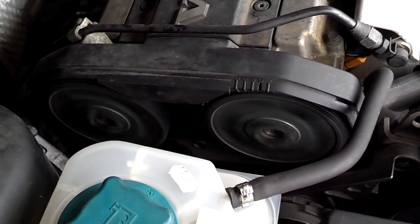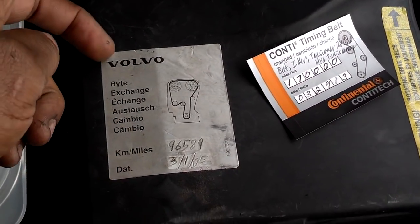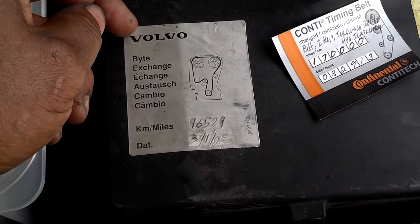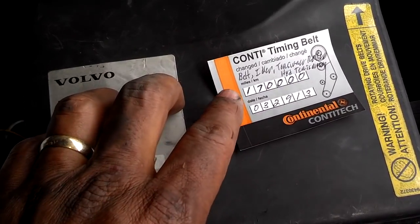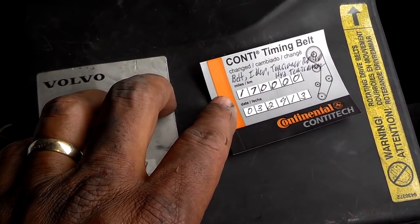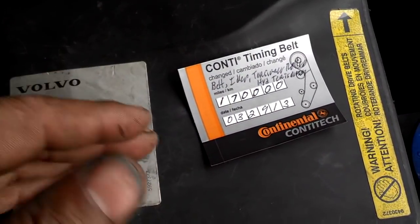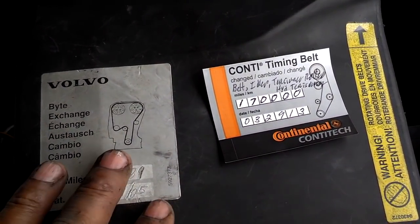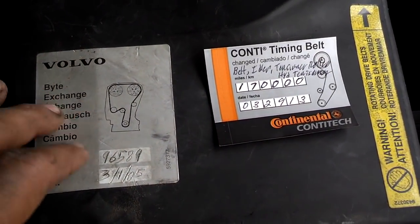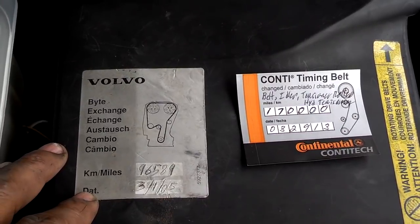Before I put the wheel on, I want to point out that you need to remove the old timing belt cover sticker because it no longer applies. I round the miles to the nearest 500 — the car has 169,677, so I rounded it up to 170. I put the date, noted that I changed the belt, the idler, the tensioner roller, and the hydraulic tensioner. If I would have changed the water pump, I would have written that on there as well. I'm going to stick this sticker inside the glove compartment door — I don't know if it'll hold up in the engine compartment as well as the aluminum ones from the dealer. Thanks for watching. If you feel this information was beneficial, please like it and share it with your social media friends. Go ahead and subscribe so you'll get notifications of future videos. Feel free to visit my website robertspano.com and post questions — thanks again for watching.